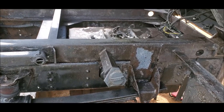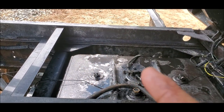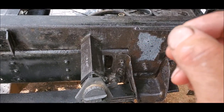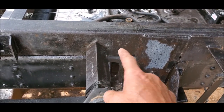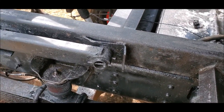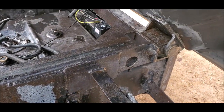And one other thing, the one word that comes to my mind whenever you apply this with a paintbrush is intentional. You have to be very intentional whenever you put it on, because you want that rust cutter to really get into all the pores. And you can see it changing colors, and you can see it soaking into all the pores in the metal. So you have to be very intentional with it.